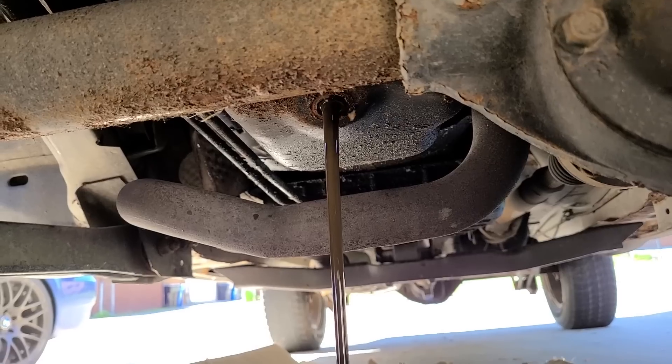I'm just letting this thing run. We have a fan that is working, as you guys can probably hear — this fan is blowing real nice. Let's look at these pulleys. Let me know, Jeep guys, 5.9 guys — is the crank seal supposed to be that far out? That looks a little weird to me. Power steering pump is good, water pump looks new. A little bit of a leak here from the trans cooler lines — we might just have to tighten that up or get a new hose or clamp, no biggie. The fronts do most of the stopping, but these rears look real nice — brand new, there is no lip at all. These will clean up with a few more miles. We don't even have to do brakes, and there's no pulsation — the rotors aren't warped. Everything is good to go.